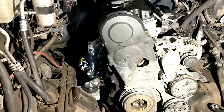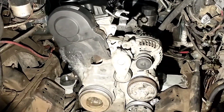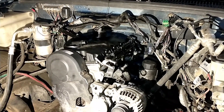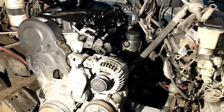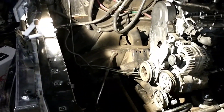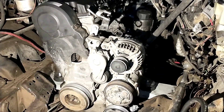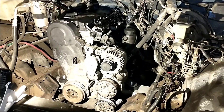We'll go ahead and pull it back out, finish all the welding. It needs a new oil pan, and we're going to reseal the tandem pump and the coolant flange — it has the metal coolant flange. We want to get all that sealed up since we won't be able to get to it afterwards. Then get it back in and start hooking stuff up. It's pretty exciting to see it in there. The coolant hoses are going to be very long, but that's just part of the deal.